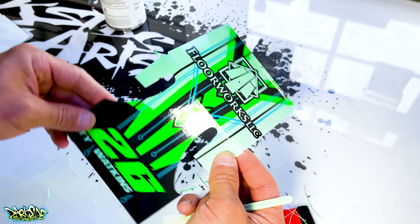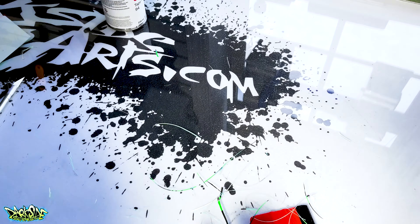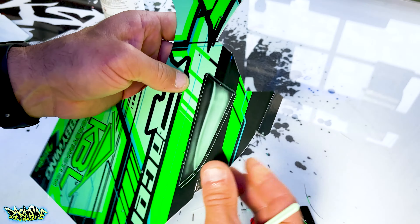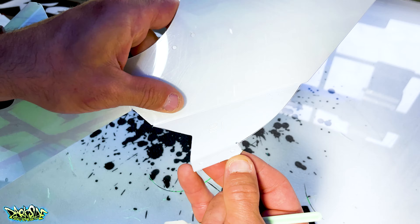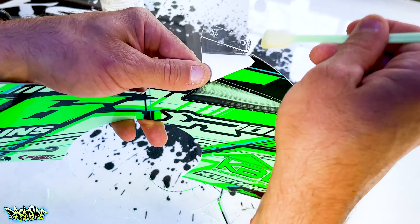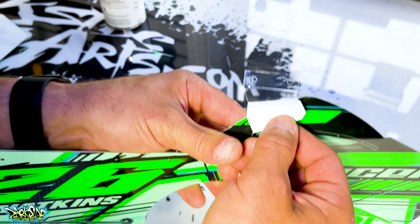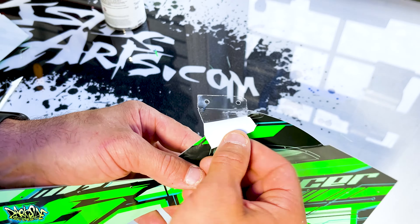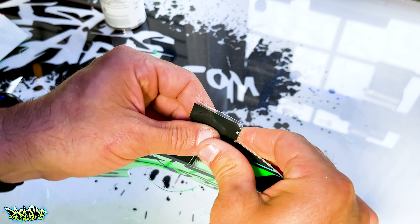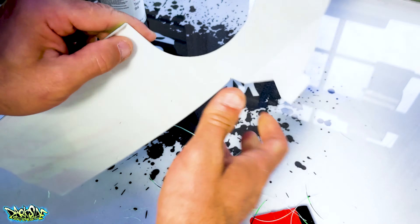I've finished all my trim work and I'm going over all the pieces now. Everything looks good — inspecting from the back and front, zero air bubbles. Going through piece by piece to show what I do when doing an install for a client. This area right here could use some primer, so I'm just going to dab that, let it dry, put it in the black there. You can see there's just a little bit left right there. Once it's dry you can bring your vinyl up and over and the bond is much better — that should no longer give me an issue.